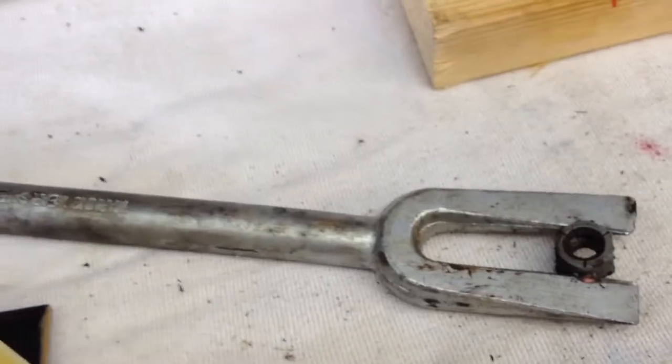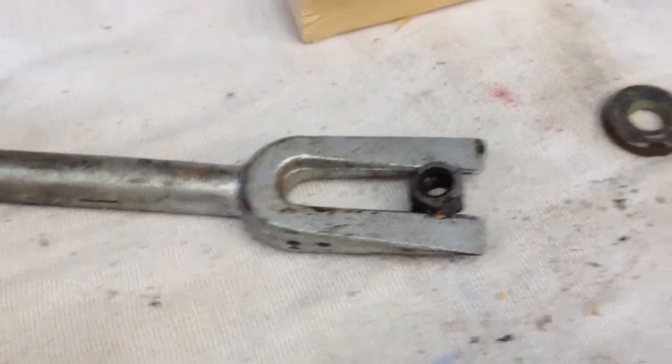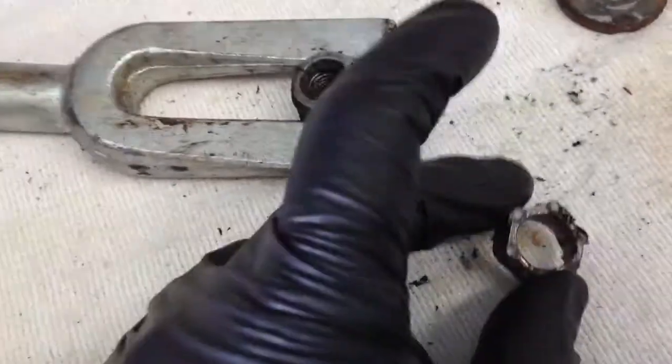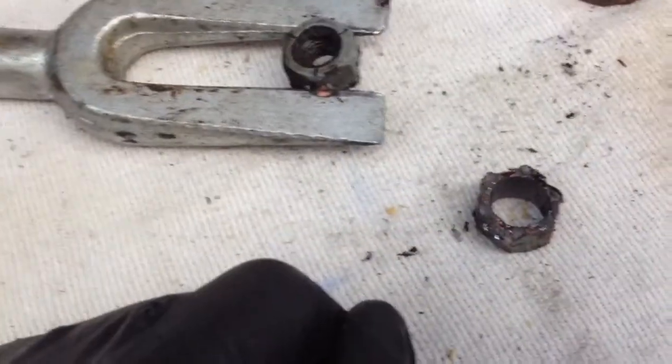So I was going to put a quick video on this. The angle here is held on by what looks to be about six or seven different little tiny weld spots — pretty simple. I ended up using one of my pry bars here that was a pretty large size. On the first one, after dealing with it so much, I ended up just fitting it in and basically just applied some force and it popped right off.